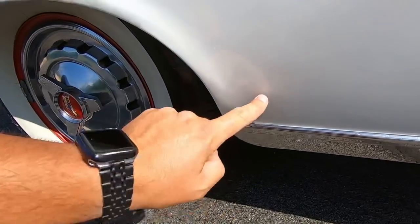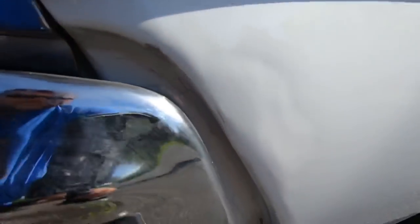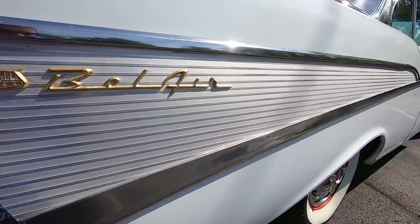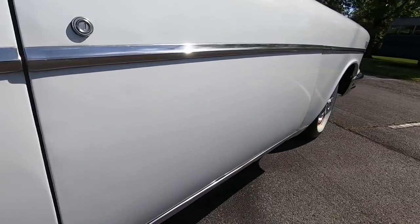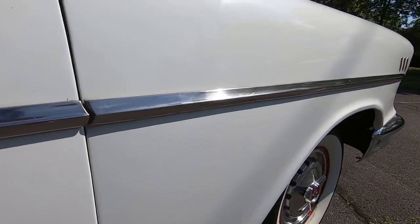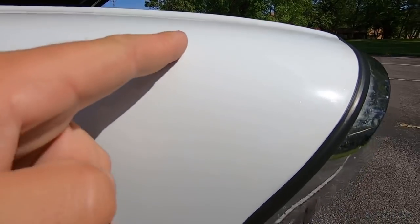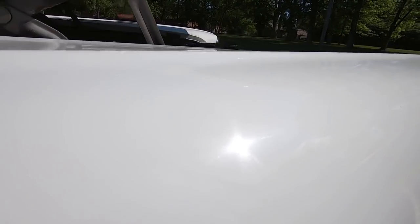Paint's a little thick on the corner there. Coming down the back, a little bit of body work right here as well. There's a dimple in the paint, and this back quarter has got some work done to it as well. Looking down the middle — trim's not in perfect shape but still looks pretty good. Light scuff on the trim there. The top part has got some chemical peel — tiny little dots. It's on top of that fender — real small stuff.